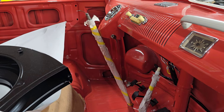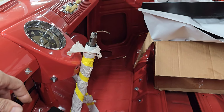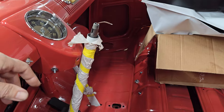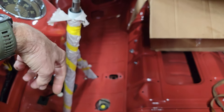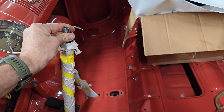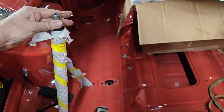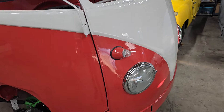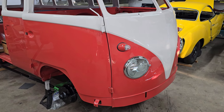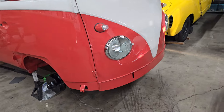Unfortunately, the steering box for the '59 bus — which was rebuilt and had been all painted — the owner got the rebuilt steering box from a different vendor, and it's really really tight. We loosened the adjuster all the way — those of you familiar with these steering boxes will know exactly what I'm talking about. Rafa removed it all the way just to be sure it wasn't somehow binding the mechanism inside, but you can't turn it at all. The pitman arm isn't connected to anything, so you should pretty much be able to spin it with your fingers. I've got pretty strong hands and I can't even budge it. So unfortunately, we're going to have to see what we can do — hopefully the shop can take it back to wherever it was rebuilt. It's kind of a nightmare, and it looks like there's going to be a delay getting the bus fully on the ground.